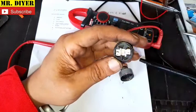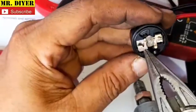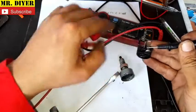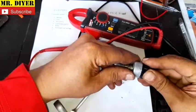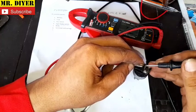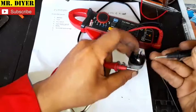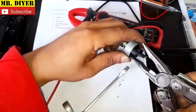There's really nothing wrong with this brake switch. I'll just twist it a little so it will touch the disconnecting plate some more. Let's confirm with our continuity test — it should light up. And it does. Let's do that here as well — and it is. Let's assemble this. Confirm again before we lock it in place — it's locking. Turning on, turning off. Turning on, turning off. Confirmed.